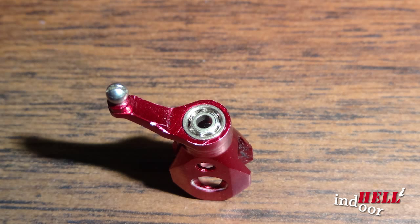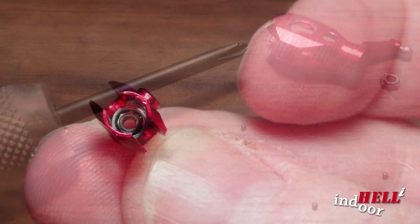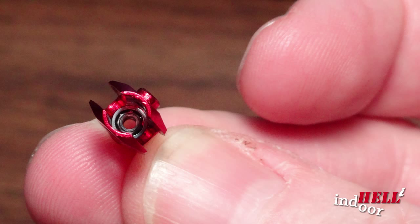My heli started flying pretty poorly and started doing some shaking. On further inspection, I realized I had a broken bearing in one of the blade grips. When I disassembled the grips, the damaged bearing actually fell out of the grip, so I knew that bearing was bad. Then I placed the shaft back through the other bearing on the inside and spun it, and noticed that it was real rough and probably needed replacing too. So I ended up needing to replace both bearings.